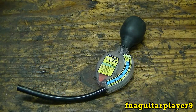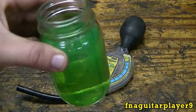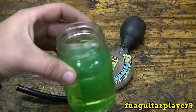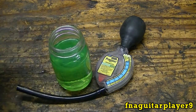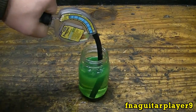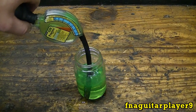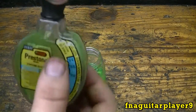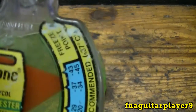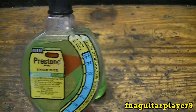Let's go ahead and check the antifreeze straight out of the jug, and then I'll compare it in my truck and see what my truck is good for. I put some antifreeze in this little jar — and since antifreeze can make you sick if you drink it, I'm going to throw this container away afterwards. All you do is squeeze this and pull some up into the tool. It's supposed to fill up to this line, and we're pointing just a little bit above 34 — actually reading about 40 below.